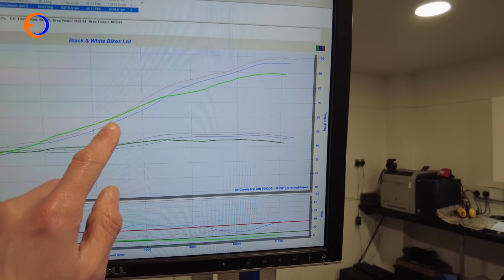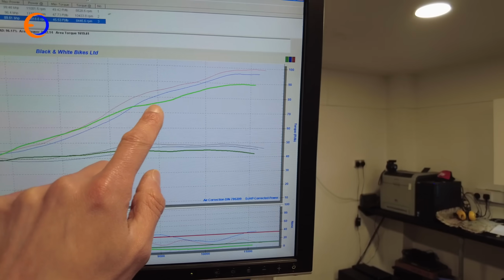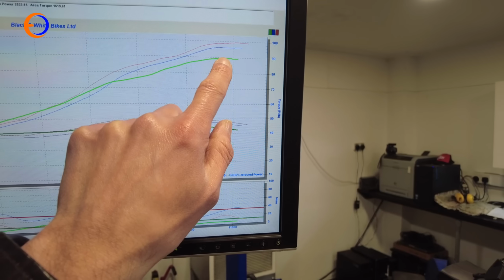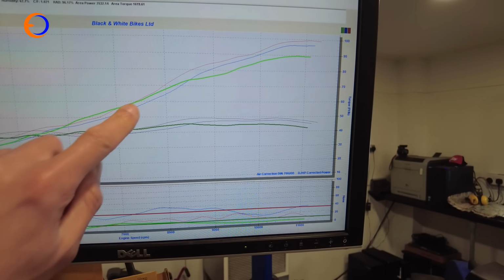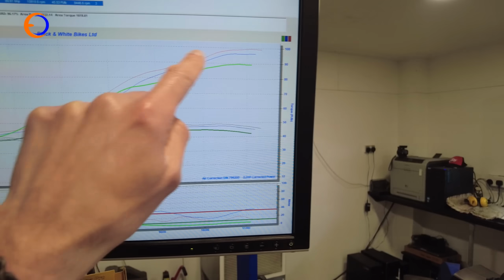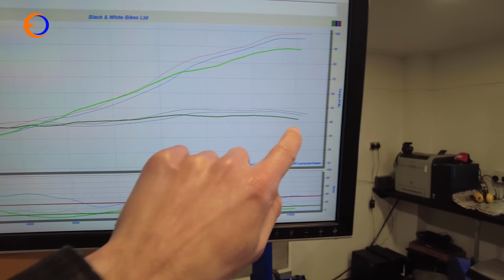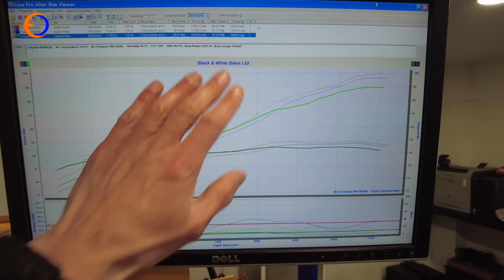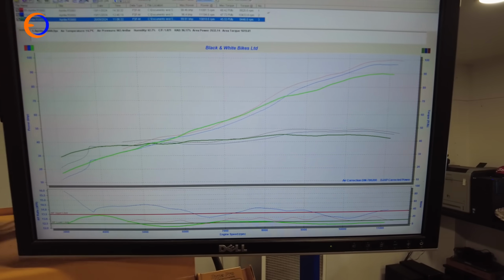Really interestingly, this big green line is a Sport Bike Cup RS660. So basically, this is a standard engine bike. It is a little bit rich fueling, but the big difference here is 89 horsepower, 99 horsepower. This bike, from basically 7,500 RPM onwards, goes absolutely miles better than a standard engine bike. You're basically 10 horsepower better, all the way from 7.5 to 11.5, and on track that makes a massive difference. So possibly ignore the headline figures, look at the improvements, look how good the bike's going to ride. That is it. Job done on the dyno.